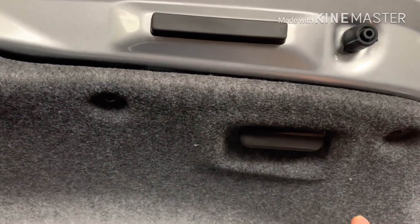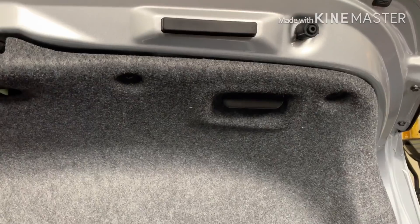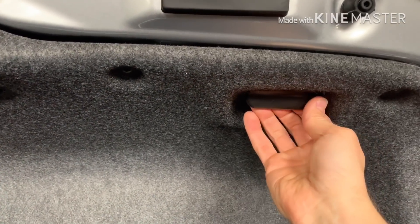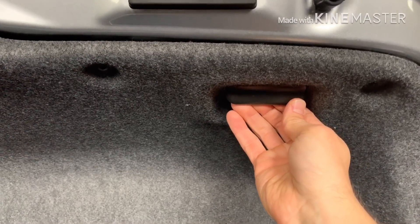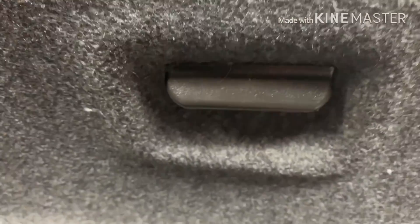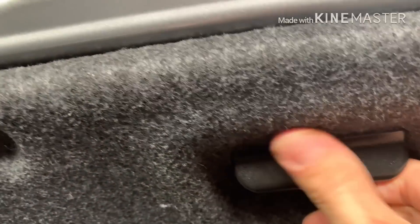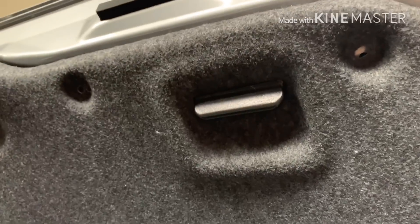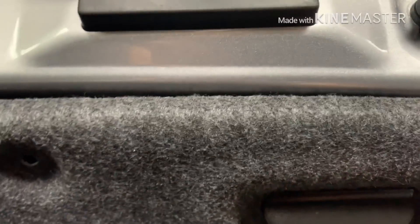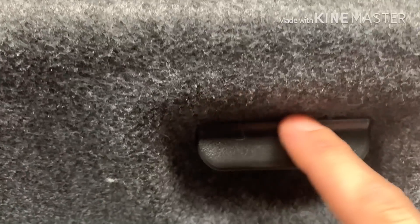I just have to put the pins back in. No screws, it's already made for it, looks really good. For $10, it's a part Honda left off to cut costs but it's neat to add. Just make a slit and slowly shave it away, then test fit it — if you do too much it'll be sloppy. I saw videos where there's a big open space and it looks aftermarket; this way it looks like it came like that. If it's too big once you cut it, you're going to see it all open.